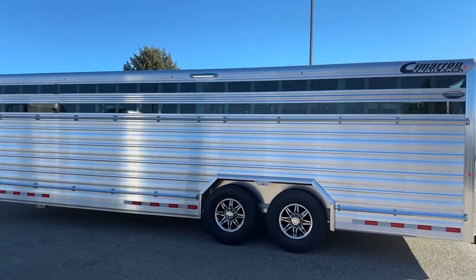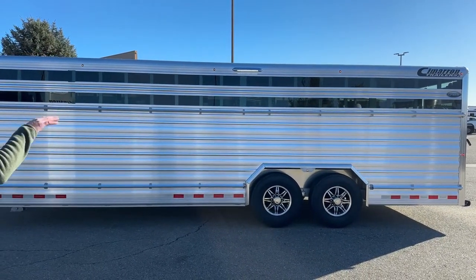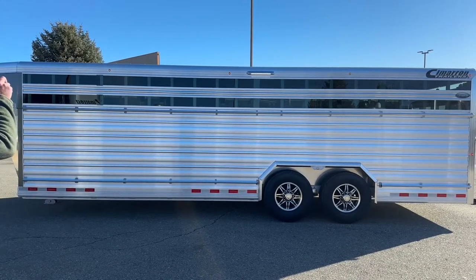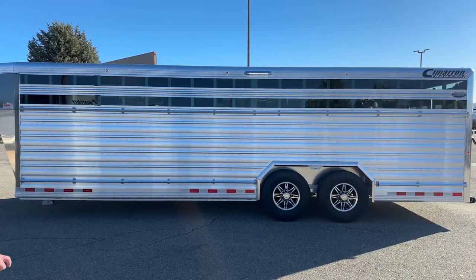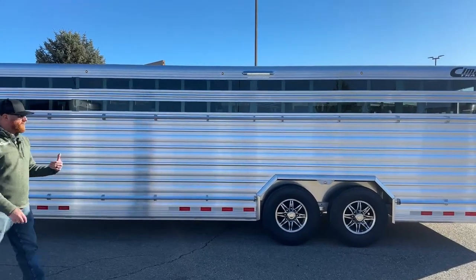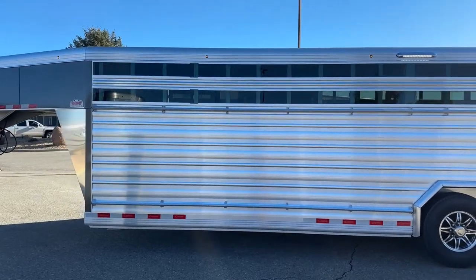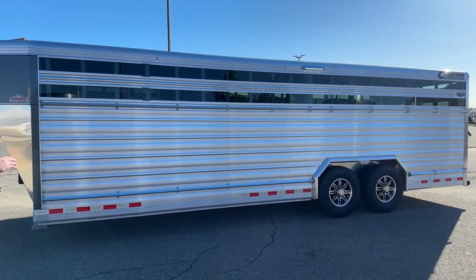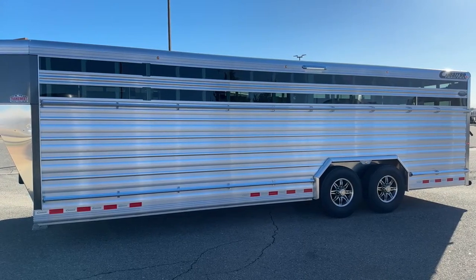On the driver's side, you're going to have another 16-inch awning light splitting the length of the trailer, and plexiglass. We put a few more marker lights on this one — normally two is standard, red at the back and amber at the front per DOT. We've had customers go with lights every foot, really making it look like a nice chicken hauler. Tie rails high and low on this side as well. There's also a piece that can go over the wheel wells for additional tie rail if you're traveling in summer months at a junior national and want to tie everybody off the side.